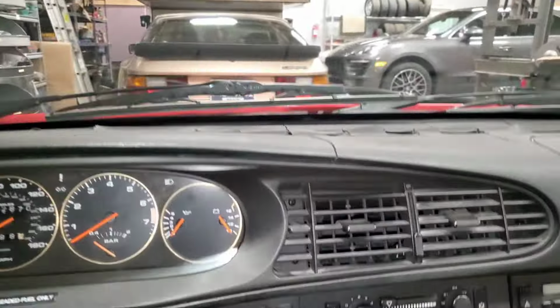So that gets you down to the instrument panel. There should be 4 screws that hold this instrument cluster in, and then once you get those off, there are ribbon connectors on the back side. Super fragile. Go easy here, because you don't want to bust up those ribbon connectors or monkey up the ribbon cables themselves. This is the trip counter reset, right there, that little button. And I was not aware that there was a light mounted up there. Isn't that interesting? Okay then. Oh, that would be to light up that slider on the vent. I'll be darned. Okay, let me loosen up that cluster and I'll show you what's going on behind it.